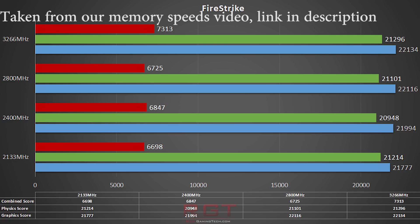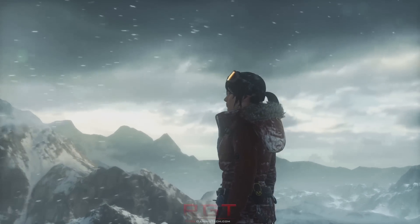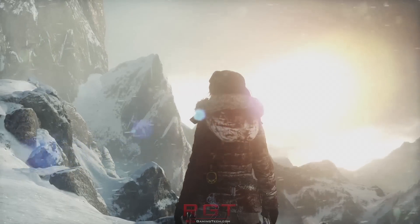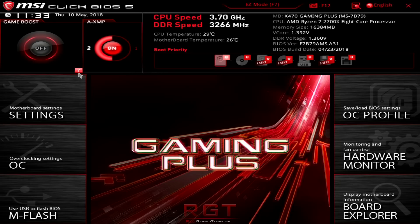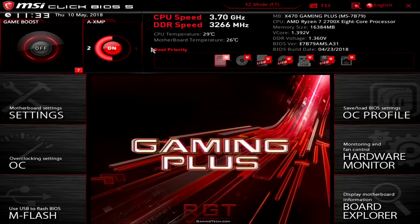We run games at 1080p. At 720p we could clearly see CPU and chipset limitations come closer into play, but running a GTX 1080 at 720p is just not realistic. We suspect that 1080p with this card is about the lowest resolution you're going to want to use in real day-to-day gameplay. We're grabbing two distinct sets of results for both the X470 and the B350: the first leaving the clock to manage its own frequencies on auto, and the second manually clocking the CPU across all cores to 4GHz. By doing this, we hope to isolate any benefits the X470 series board might have in boosting, and demonstrate performance if users opt to manually tweak clock speeds themselves.